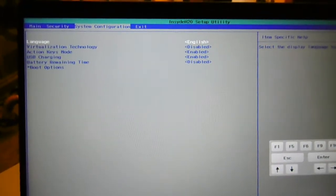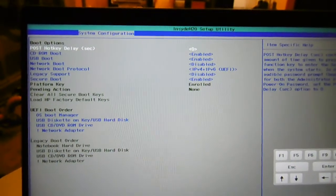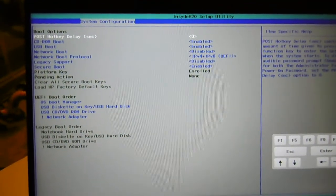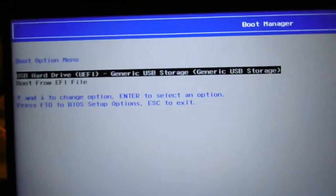So we're going to hit F10 and go to System, then go to the boot option. Right now the legacy support is disabled and secure boot is enabled, so we can boot from UEFI. Let's do the secure boot — it's fine. Do F10, yes, and then F9 to change boot order and boot from the USB UEFI.